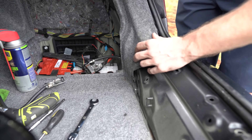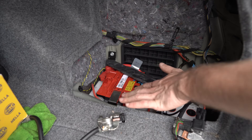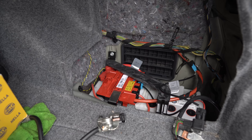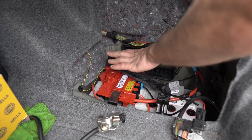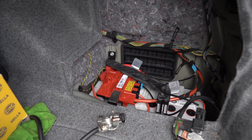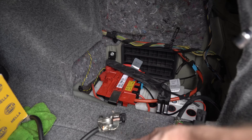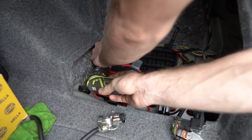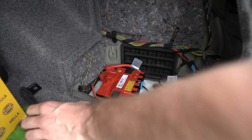Make sure it's snug. At this stage I wanted to remove that fuse right here and make sure everything is intact, as it should be. I wanted to double-check and be sure there are no missing or loose connections, or any rust or oxidation. With that, we need to remove that bracket right here — that's two 10mm screws. Make sure to hold that screw because if it falls down you're going to need to remove the battery.